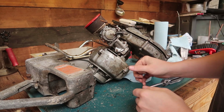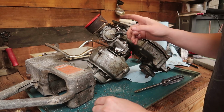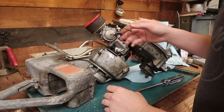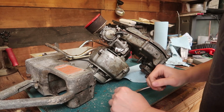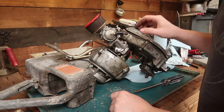And this makes me happy. If I understand right, what I saw from that means that this definitely is running off fuel from the carburetor. Because if it was just running off the fuel from the cylinder, it would have run only a few ticks and that would be it. Whereas this actually ran for a little bit and I could throttle it a little bit.